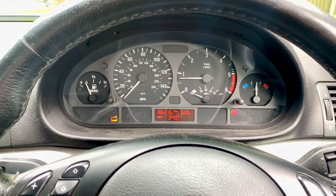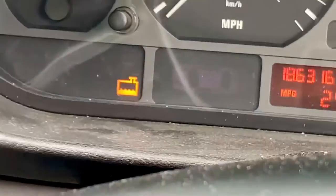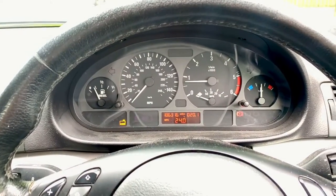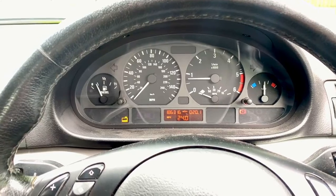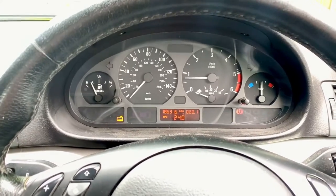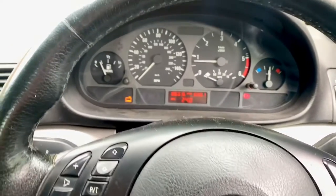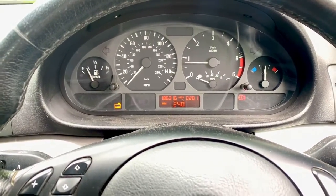Welcome back to the channel. This is driving in my BMW - as we can see I've got a warning light on the dash, and coupled with that light I don't know if you can hear this on camera but it sounds like I've got a budgie under the bonnet as well, which is a squeaking alternator belt. That indicates to me that something has leaked and spunked up coolant all over the place under the bonnet, so let's have a look.